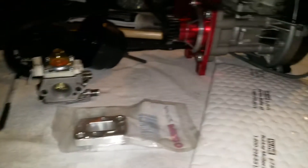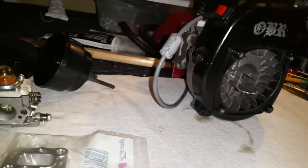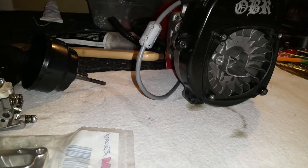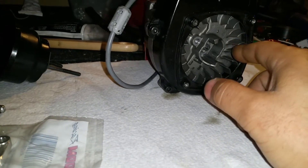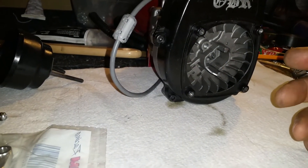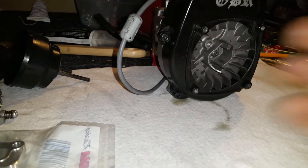Update on the pull start — I should have bought 10 regular pull starts. That damn turtle racing pull start took a shit. I was pulling on it trying to get this motor started, and I should have just dealt with the issue at hand, which was the carburetor — I'll admit that. But it should have taken no shit. I'm only pulling it, and even though this is a high compression motor, I think that's the problem with those. Plus they got a plastic cog in there — they sell chrome cogs — so they're setting that up for failure. The spring slips off the plastic cog when you're pulling it. So I'm gonna order the chrome cog — it's 14 bucks.